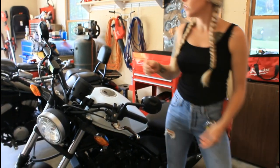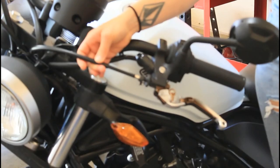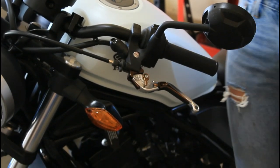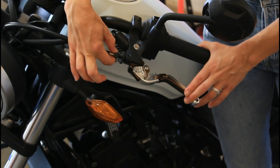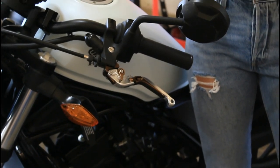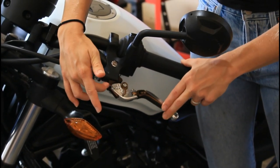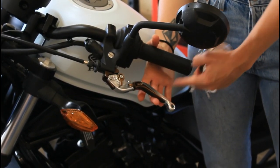One of the big things you also want to look at is your clutch cable — check for any signs of wear, because adjusting it if it's worn or something is wrong with it isn't going to do you any good. As a general rule of thumb, if you look at this lock nut and screw, if you can fit a nickel in there, that's about your general free play. However, we're going to be specific. You can check it here, or your owner's manual may have you checking out here as well.